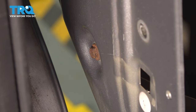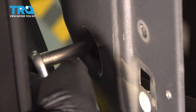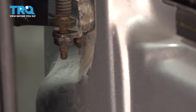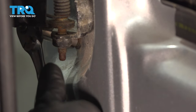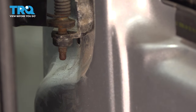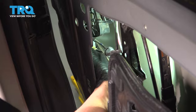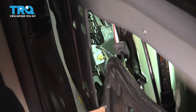Now to make things easier, we have to unbolt the rear window track. Towards the bottom of the door on the rear, you'll see a 10 millimeter bolt — remove it. Right behind the top hinge there will be another one, also 10 millimeter. With those taken out, we can move the track around to maneuver the latch assembly out. Grab the latch assembly, twist it, turn it, and squeeze it past the window track.